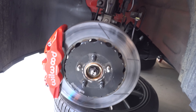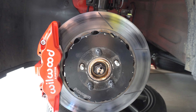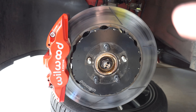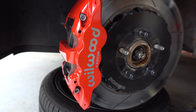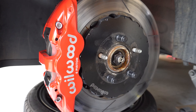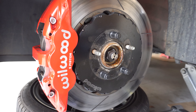Here's how it looks. As you can see, it's used — the previous owner did a couple of track days at Track 19 America. It looks relatively good; there isn't too much wear. The rotors aren't heat-checked and the pad layer you see is from the GS1 street pads. This is the Wilwood Aero 6 dust-sealed six-piston caliper. The piston volume is about 9–10% less than stock, so it requires more pedal pressure for similar clamping force, which is actually desirable on track since with stock brakes it's easy to trigger ABS with aggressive pads.